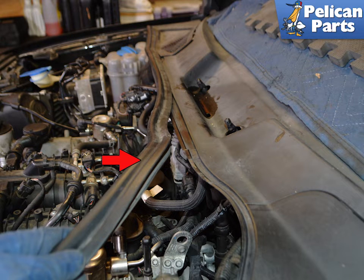You are going to have to completely bleed your brake system after this job is completed. Do not try and drive the vehicle without completely bleeding the system, including activating the ABS pump with your scan tool.